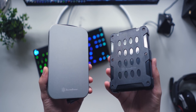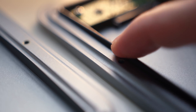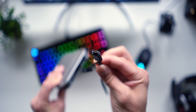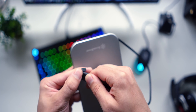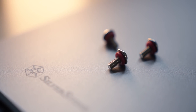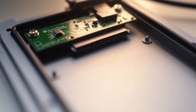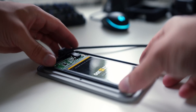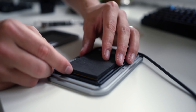The SO-2 has the same idea for external storage but a totally different approach. It's more elegant because it's literally just an aluminum slab, and it has IP68 water resistance — it can withstand 60 minutes in water up to 1.5 meters. You access the internals by unscrewing six screws, all of which have a rubber grommet around them to prevent leaks. Inside, the SSD cavity has little pegs at the bottom to hold the SSD in place. We also get two foam pads depending on SSD thickness, and a thermal pad because the entire aluminum enclosure can act as a heatsink.